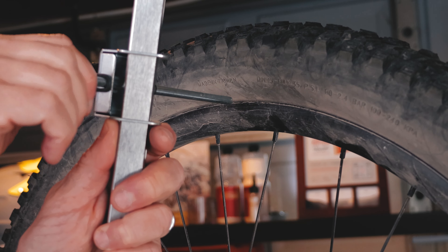I'll slide the gauge up a bit and bend the hanger inwards. It's important to go slow on this step and apply controlled pressure. All derailleur hangers bend differently — some are softer and bend easily, others are quite firm. Just go slowly when you're bending and check to see how much you've bent it after each attempt. What we're looking for is an equal amount of space between the rim and the pin at the top and bottom of the rim.